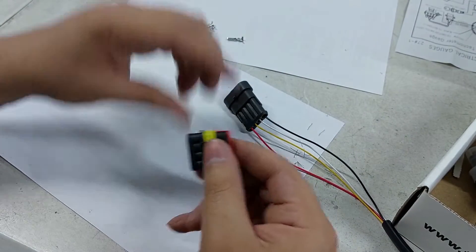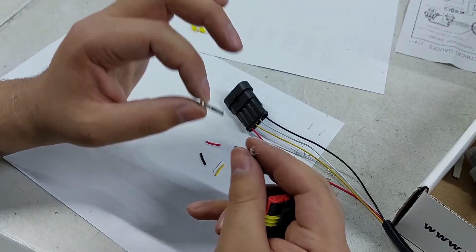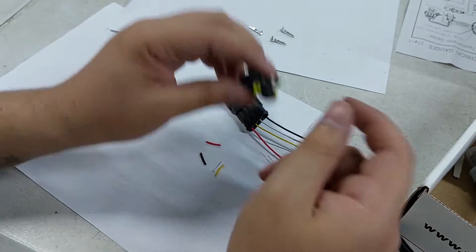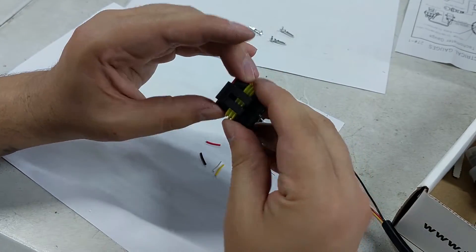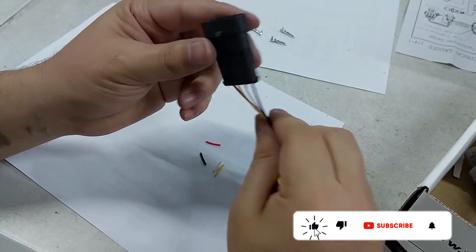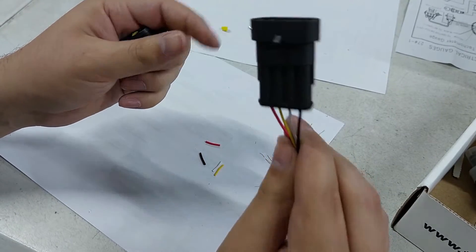Now I'm going to do the other side of the plug — we're going to use three pins: two negatives and a positive from the relay. If you watched the other videos you'll know we had a relay board made, so there's a relay ready for this. I'm going to run a positive wire from the relay to the plug and then a negative, and that board has a negative connection that goes straight to the battery terminal, which is what they recommend. They do recommend you earth this sensor at the negative terminal because any interference or resistance in the negative will give you a different output, since this is a voltage-based sensor. So a good earth is really important. This will earth to the relay board which is directly connected to the battery terminal.